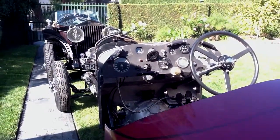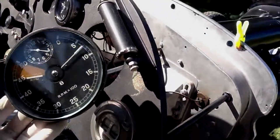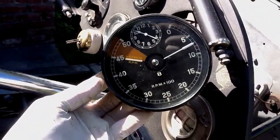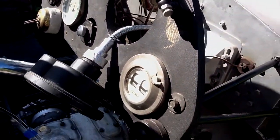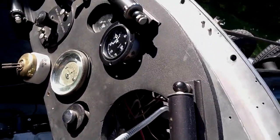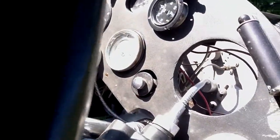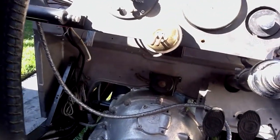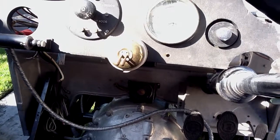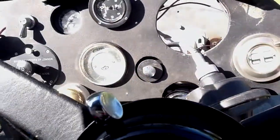Just getting everything kind of working right now, setting it in the sun. The speedo tachometer was a little slow right off the get, and the reason for that is because it hasn't moved for probably 30 years — it needed a little lubrication. We didn't put any in it yet. At 700 RPM idle, we have looks like over 30 pounds of oil pressure. Both amp gauges are working, and we'll start seeing the Bentley oil temperature go up. Fuel temperature runs very, very cool.